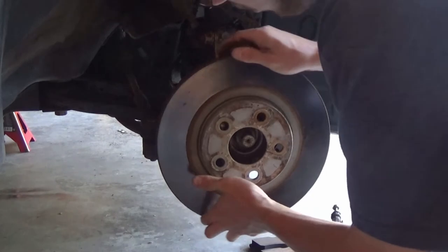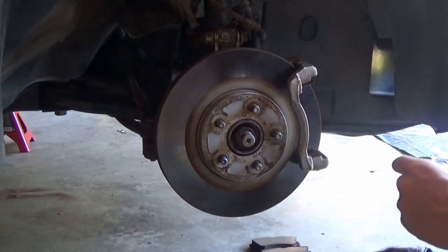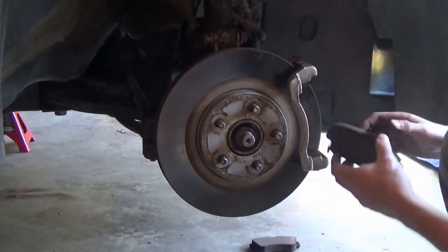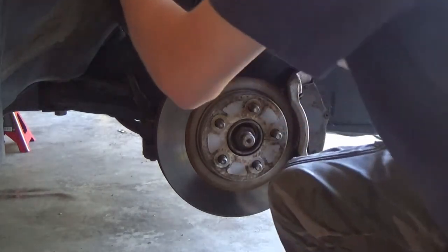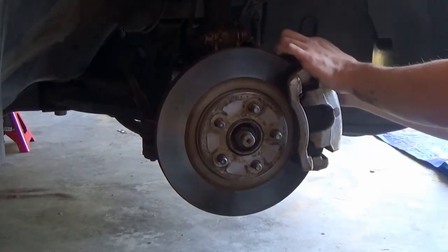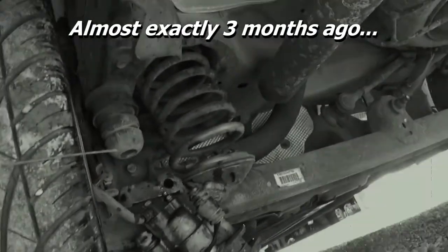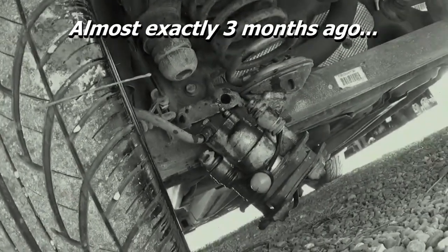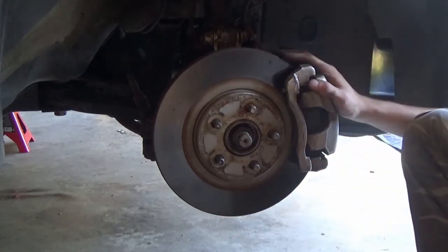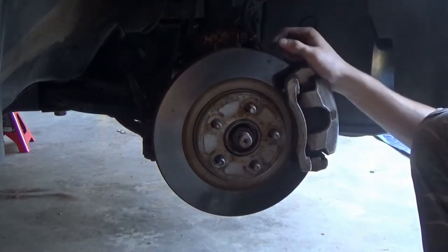Now that that's all done, we start putting the brakes on. Brake rotor goes on — this is the easy part. The caliper mounting bolts I'm pretty sure torque to 50 foot pounds. Brake pads go into the mounting bracket, and I'm going to cut the zip tie I used to hang up the caliper. These smaller bolts normally torque to 20 foot pounds but I'm going a little more — about 25 foot pounds — because past experience I had a rear brake caliper dragging by the brake hose. Everything is pretty much all set, so I'll get the wheel on and get the other side finished up.